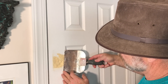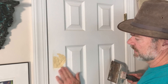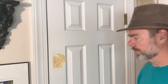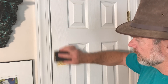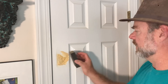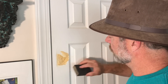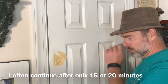Run a level tool over it like so to ensure nothing is rising up. It's easy to work with in a semi-set state - it's kind of like Bondo, you can carve and manipulate it. I've got nothing above grade there, so I'm good to go. You can also sand it down when it's set but not totally hardened to keep the level the way you like it - it's much easier to sand at that point. Get excess out of any grooves and off the fade edge.